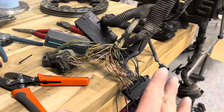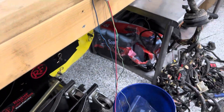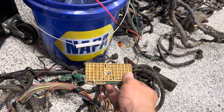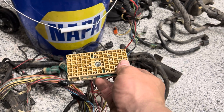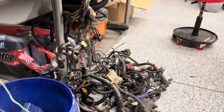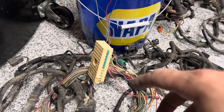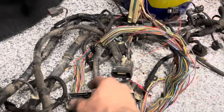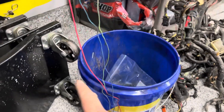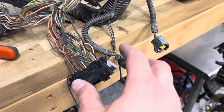Getting you caught up: I've got all the simple pin-to-pin connections transferred to the 70-pin Coyote connector, and I've started getting some of the power feeds and cooling fan triggers from the fuse box connector — this is the C1035B. This is actually part of the 4.6 engine harness, which is what I required the client to supply. I thought I'd have to add more pins, but I realized at the end of this loom is the engine connector for the PCM, so I just had to untape it and the length will be perfect to the body connector on the other side of the header.